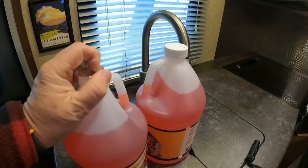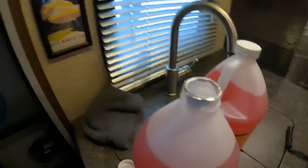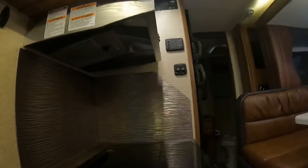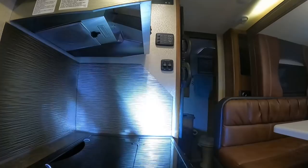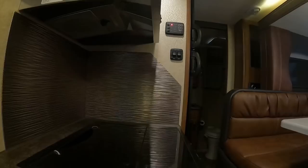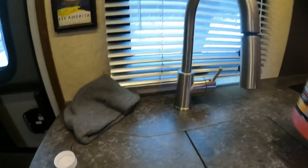Let's get a jug. I've got more in the garage. What I'd really like to do is pour this into a five-gallon bucket, but we'll make it work. You go through these pretty quick and I don't want to lose prime on the pump. I want to get that hose all the way down in. Now I'm going to turn on the pump, which is right over here. We know it's working because we've got pink — it's flowing. Woo-hoo! So this is how you winterize a trailer.